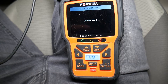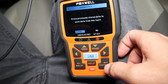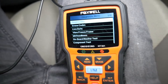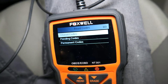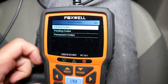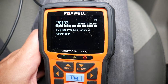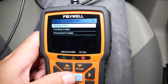The scanner establishes communication and shows one code found in the system. Click OK and you'll see two different modules — scan both of them. The codes for this car are usually under the second one. I always recommend checking both stored and pending codes, because a pending code means it's present but hasn't transferred to permanent memory and may not have triggered the light yet. The code we get is P0193: Fuel Rail Pressure Sensor A Circuit High.